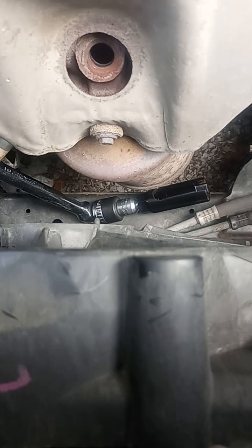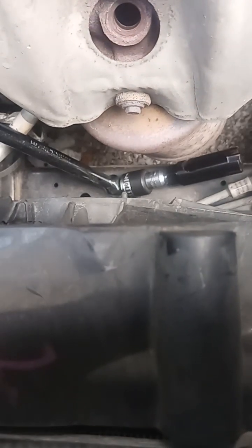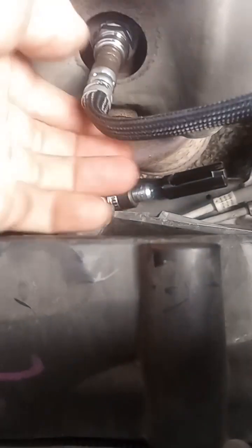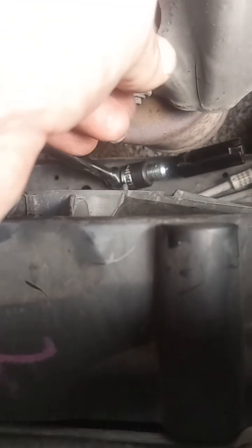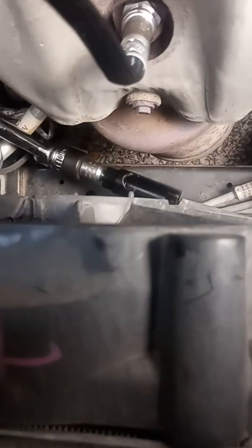Make sure you have clean threads, like you would have a clean gasket surface. I always thread things in by fingers first so I make sure not to cross-thread. Cross-threading the manifold will not only cause a leak at the O2 sensor where it will fail to seal, it will also completely damage the manifold to the point that you need to replace it.